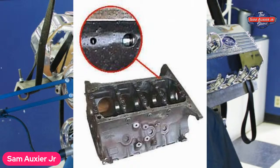I always shimmed it closed. So oil pressure was 100, 120 pounds cold, and we never, ever allowed it to operate because Ford told us that the two throws in the rear of the block only had 20 pounds of oil pressure there at 7,000 RPM.